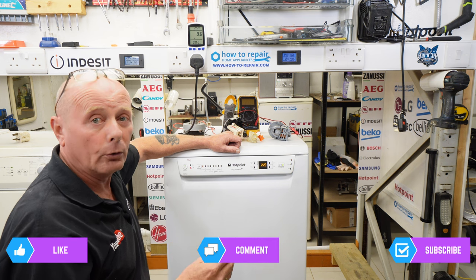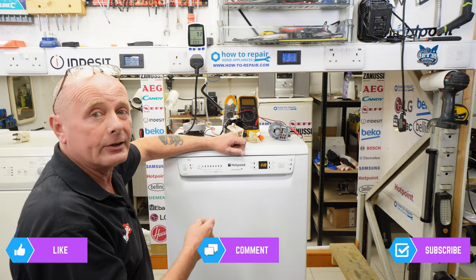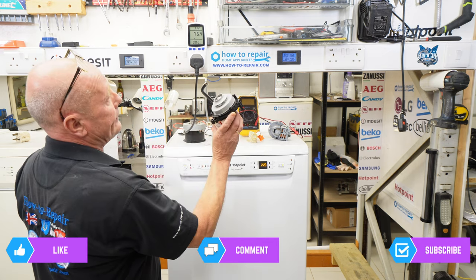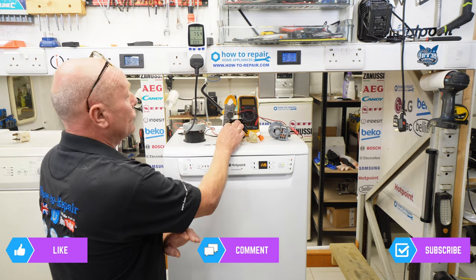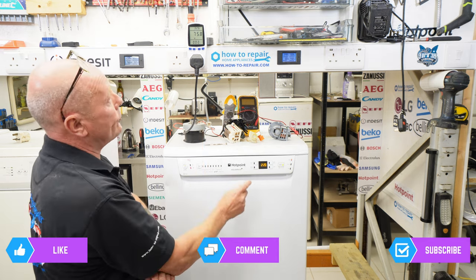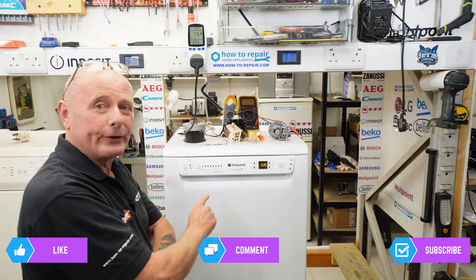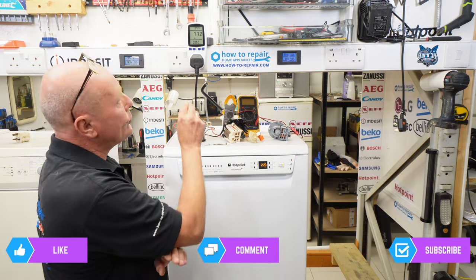The main motor has now kicked in. The machine has finished filling and we are now drawing 75 watts of power — the motor is rated 70 watts and it's under load because there is water in the machine. The machine will continue to wash until the heater energizes. We should hear a click on the door for the soap — and there it was, perfect timing. The soap dispenser clicked, allowing the flap to open. The wattage only moved slightly — certain components are very hard to detect because they only draw a small amount of wattage.